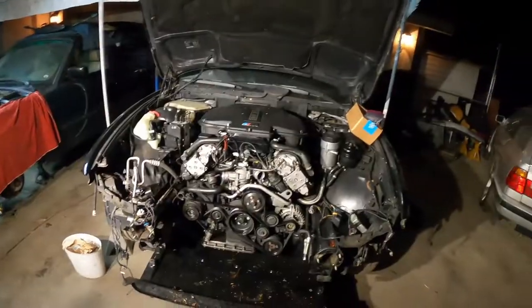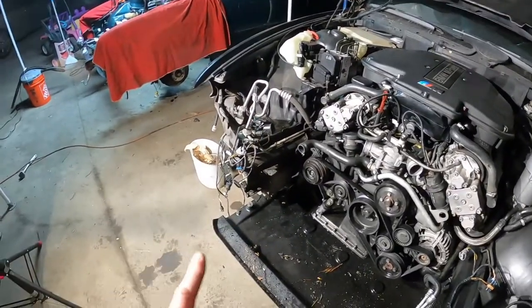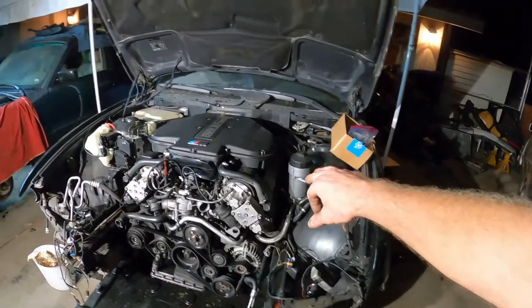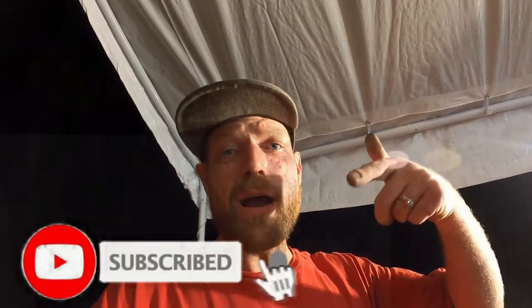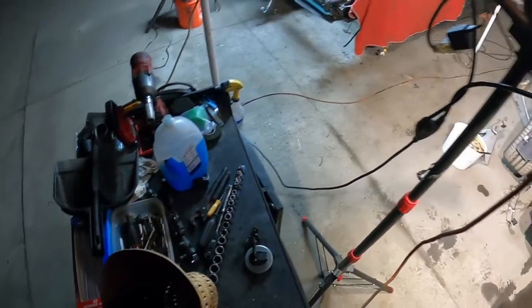What's up everybody, welcome to later on in the evening — kids are in bed and wife's busy, so let's get some work done quietly. Here's where we're at: jacked the car up, drained the fluids, need to pull off that belly pan, disconnected the intake and the radiator, evacuated the AC lines. Now we have to pull the belly pan off, start pulling the power steering stuff, get into the ECU, start taking that out and unplugging stuff. Anyway, guys, hope you've stayed tuned — make sure you like, subscribe, hit the notification bell so you're always notified when a new episode comes out. Let's keep going.